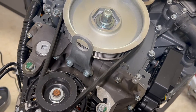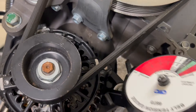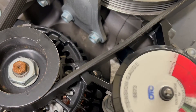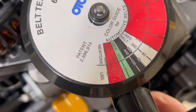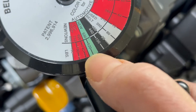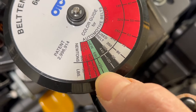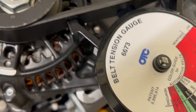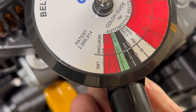The way we do this is we squeeze it right here on the port side, then do a quick release. Then we look at the indicator — this little arrow pointing to the pounds of tension. In this case we got 120 pounds of tension. You can release it a few times just to confirm you got a correct measurement. We're good at 120.